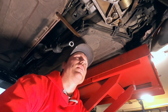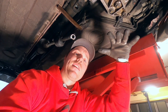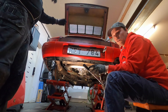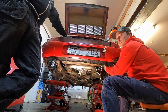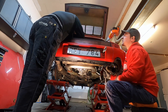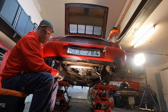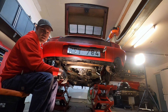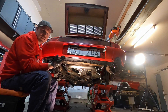I'm going to go over to the other side and loosen the engine mounts. As we now start loosening this, the engine and the gearbox will actually come down. With a long extender like this and an 18mm socket — a long socket, because the thread is typically sticking out of the bolt, at least on my car — we try to find where it is from below. You need to be careful when you do this, because you can't loosen it all the way or the engine will simply fall down. Typically what I do is loosen it a little bit and then feel from the inside if I can still feel thread on the other side of the nut.